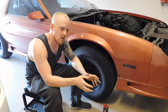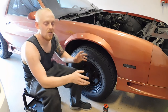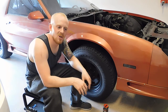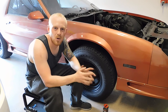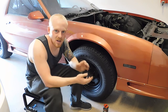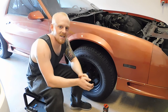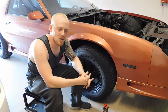Other than that, anytime you check your suspension system like this, I want to make sure that you know to retorque your wheel nuts, because the last thing you want to do is fix the problem and find out what the problem is, put your wheel on, and either fix it yourself or take it to somebody to get it fixed, and you didn't tighten your lug nuts and you end up with a much larger issue. So just remember to tighten down your lug nuts to the manufacturer's specifications and you're good to go.